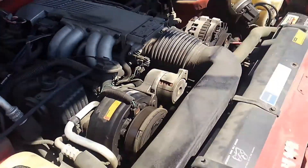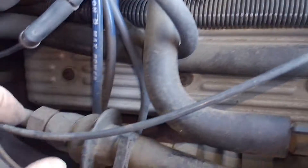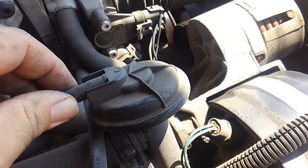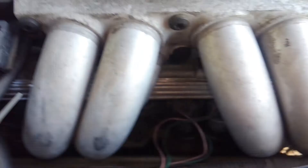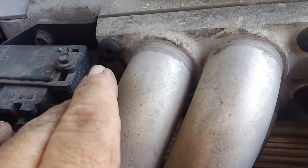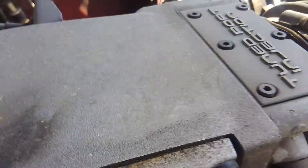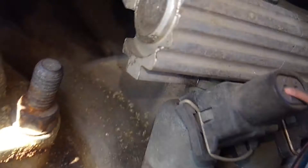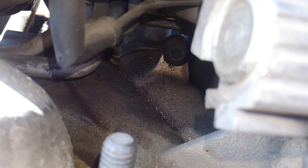They're really small lines. Another thing this MAP sensor car has differently is this vacuum line here — it controls the heater water valve, opening it up when you want to turn the heater on. So to summarize: the front port on this MAP sensor car is primarily HVAC and feeds off to the cruise control; the rear port feeds the fuel pressure regulator signal; and the one underneath the intake in the front feeds back into the EGR solenoid with that distribution block and controls the EGR valve, with an extension over for the cruise control.